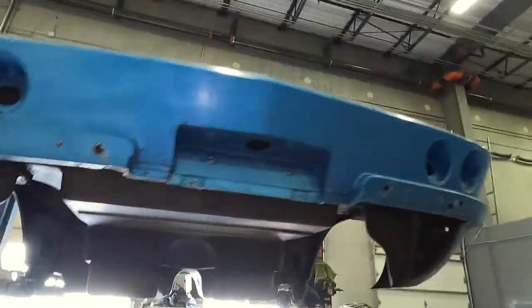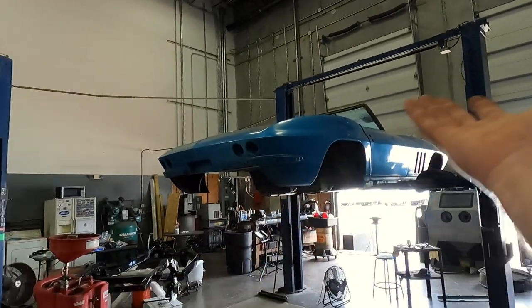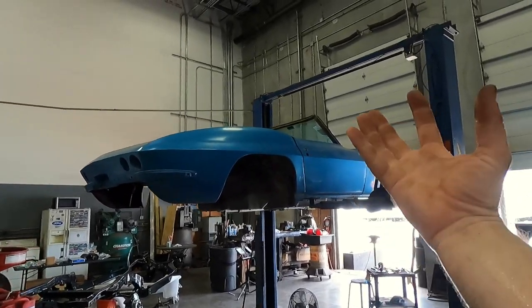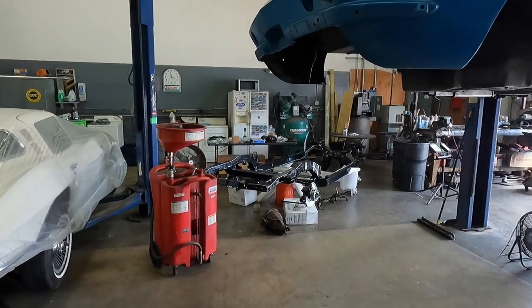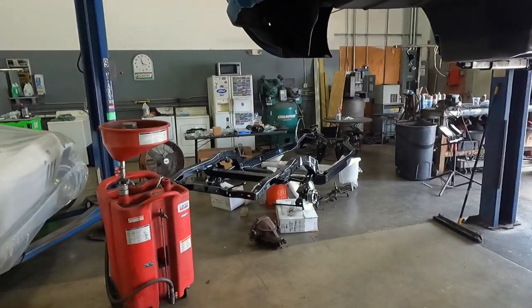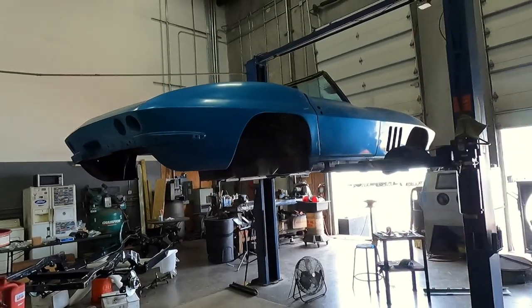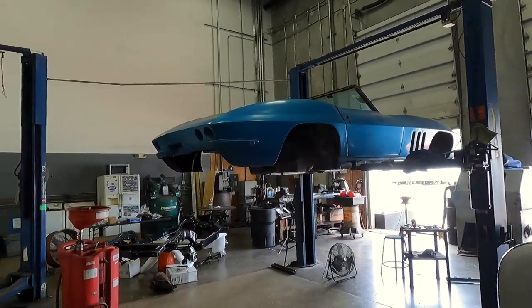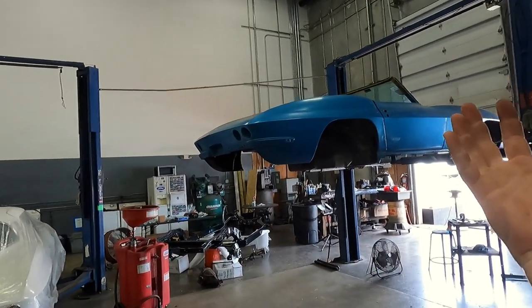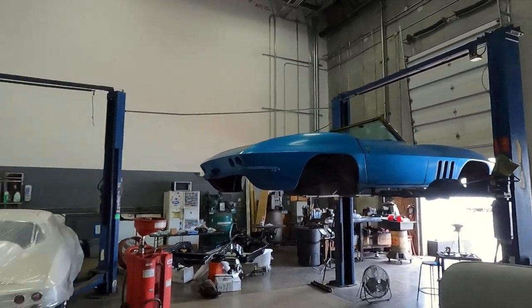The car should be in its neutral happy place before he tears into any of the body work. There are two ways to go about this — I'm still balancing the pros and cons. If I make a jig underneath the car, the chassis is going to be 100% spotless since it's not going anywhere near the paint booth. But on the other hand, we don't want fitment issues with the chassis underneath the body once it's all painted. So I think we're more than likely going to build the chassis out, put it underneath the body wrapped with cellophane — that's the best way to accomplish what we're trying to do.